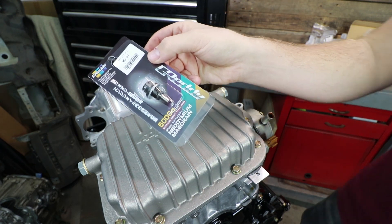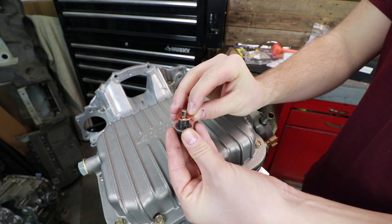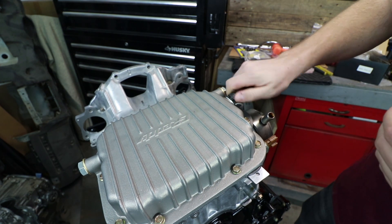Another upgrade I want to talk about on the bottom end of the engine is in the form of crank pulleys. With higher performance engines, a really good upgrade is a dampener or harmonic balancer, as they help alleviate a lot of the turbulence that goes on with the crankshaft due to higher performance and higher horsepower. When an engine is going through its normal firing sequence, each piston is getting driven really hard down into the crankshaft, putting that power out into its rotation. With each combustion happening, a crankshaft is never really stable as each one is kind of deflecting it through the firing sequence. A way to combat this is by adding an externally weighted balance to the nose of the crankshaft, which will absorb a lot of that torsional energy and help alleviate that turbulence.